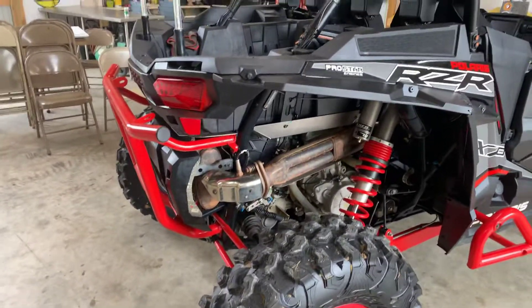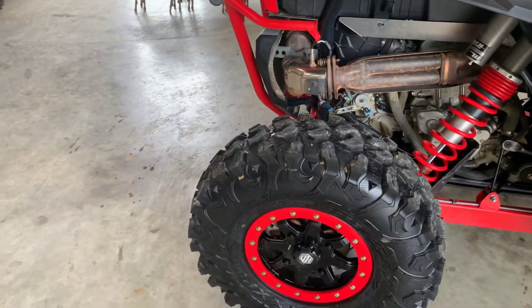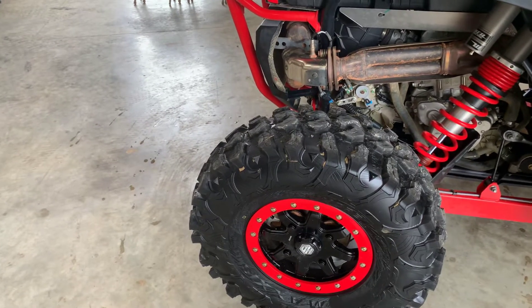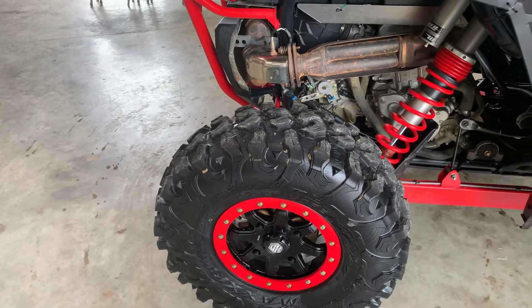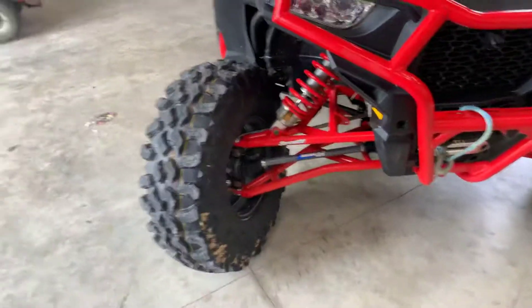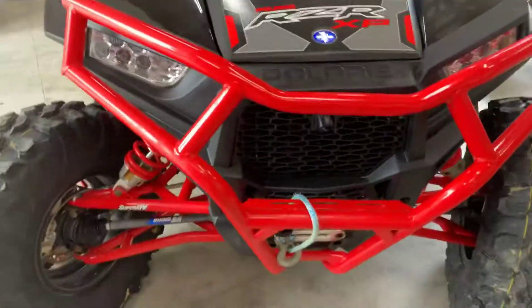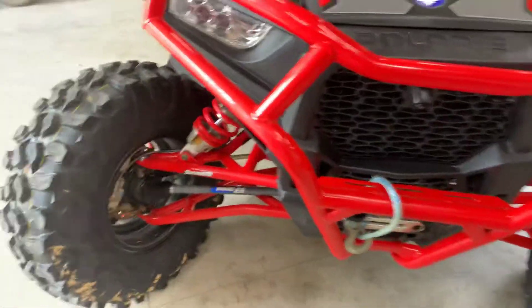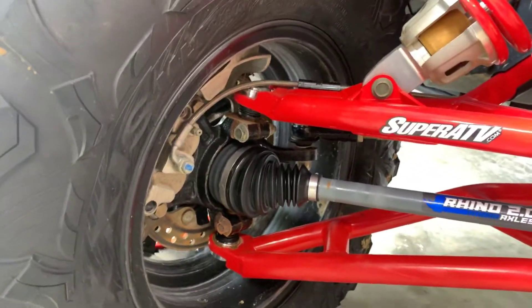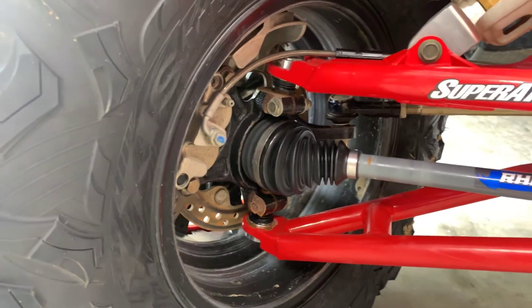I've changed the oil sooner than what the book says. Usually after every riding trip I'll put a couple shots of grease in all the wheel bearings and haven't had any problems so far. I know it gets hot in there in the summer, probably because the radiator fan is blowing it right back. I did notice when I took all the ball joints out of the old A-arms, they were starting to get pretty bad, so I don't know how much longer they would have lasted.